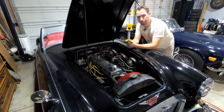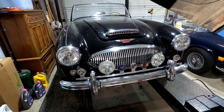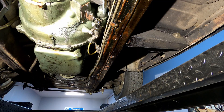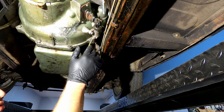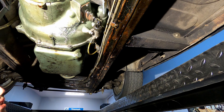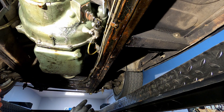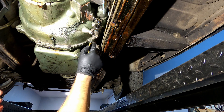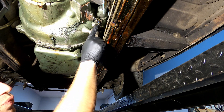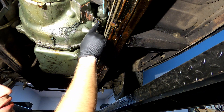Let's go underneath the car. From underneath the vehicle here, we've got our clutch slave cylinder. You can already see fluid there — it's leaking out the back, generally a mess. This is brake fluid, by the way. So if it is leaking, try not to get it on any paint or clean it up immediately. I actually like silicone fluid when working on my cars because it won't eat the paint. What we're going to do — I'll tell you about it first — we've got to disconnect it here, and you want to do that before you loosen anything, because otherwise you're going to have a hell of a time trying to loosen that bolt. We're going to disconnect this cotter pin — this is what the clutch slave cylinder pushes on — that's the rod and linkage in there that actuates the clutch.